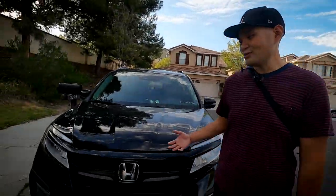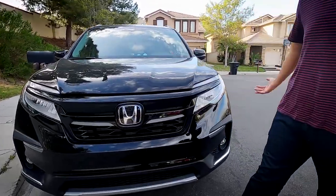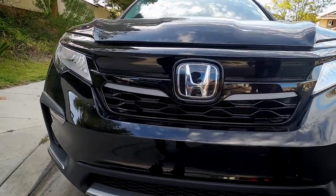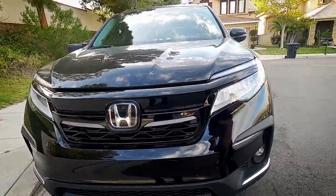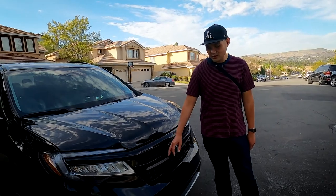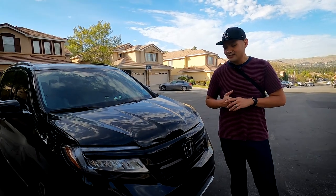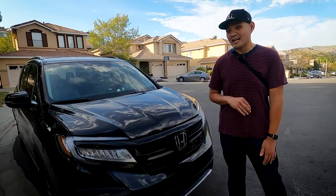Alright guys, as you can see, the grille is finally installed — it was actually installed a couple of days ago. I like it. It looks more sleek, it doesn't look as old school anymore. It gives it that more racer look, even though we're not going to be racing. It did take a couple hours to install — it's not easy. Honda does make the strongest clips. There are a lot of sensors you guys need to be mindful of — the bumper sensors, the ambient temperature sensor, which I did break. I came up with a solution by doing a 3M sticky tape on the back and holding it down with some zip ties, and it worked. If you have questions about that, leave a comment below.